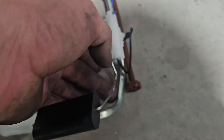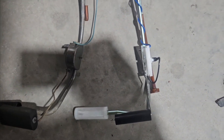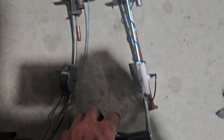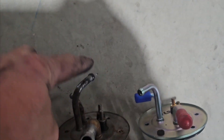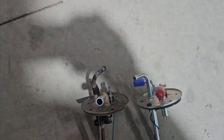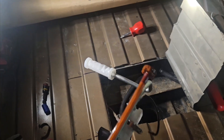The pickup tube on the new sending unit was hanging much lower, so I gave it a double bend so it now arcs to about the same angle and position. I also double-bent my float so that totally empty is basically where the pickup is - it might not read perfectly but gives a good idea. The biggest issue is the lineup points face the wrong direction, so I'm going to need longer hose and barbed fittings to make loops and connections.